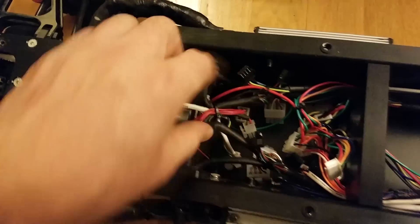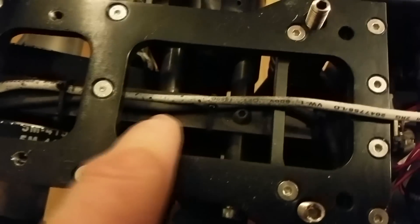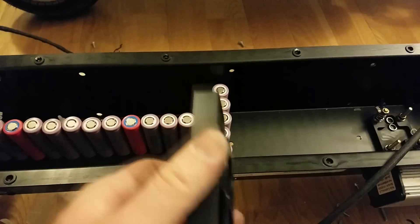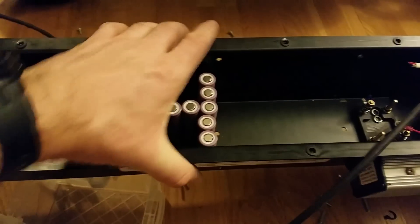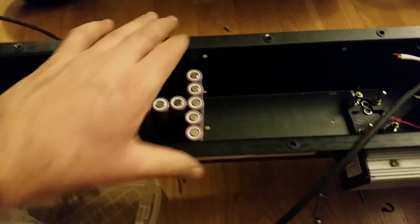So all this mess is going to be out of here. I'll cut the motor wires. This is a Kelly controller, by the way — specs are 24 to 48 volts, 100 amps. I'll be disconnecting this and running the wires through here all the way to the box. I have to put this bracket back for structural support, or actually, if I put the deck back, I think the deck will hold this together, so I might not need it. I'll think about that.